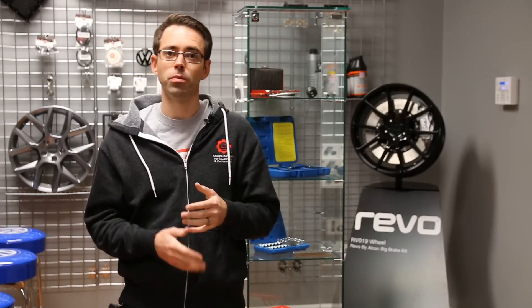The 2-liter non-turbo engines are extremely boring and also extremely slow. If you go down the road of the 1.8T, those are really probably the biggest, most tunable engine that Volkswagen had in that time. I put it in my top five VW Audi engines list, which I'll link to. That was the intro into tuning for VW Audi — really what brought them to the scene was the 1.8T. One issue with 1.8Ts now that they've aged out significantly: they had a lot of vacuum lines and other piping in the engine bay, and because those cars are so aged, everything is brittle and has a lot of propensity for vacuum leaks. A lot of people delete them. And aside from that, most of those cars have been poorly maintained, leading to premature failure. Not maintaining a turbo engine well is just not good for them.